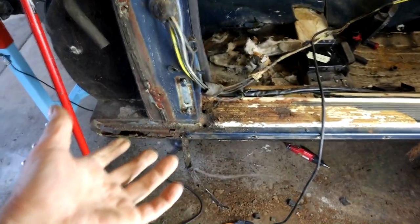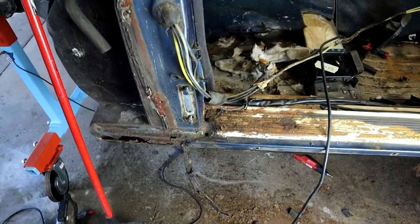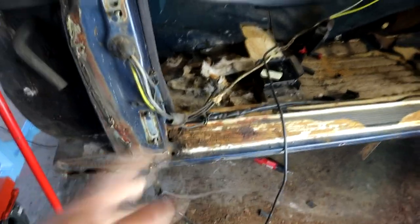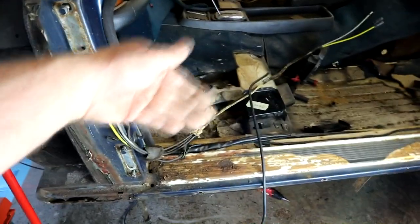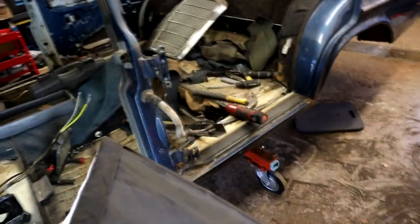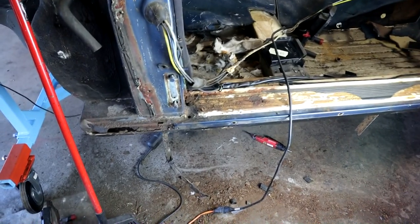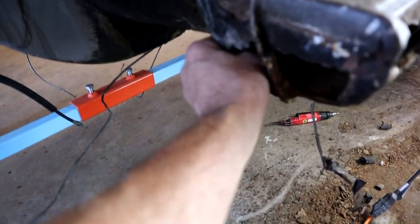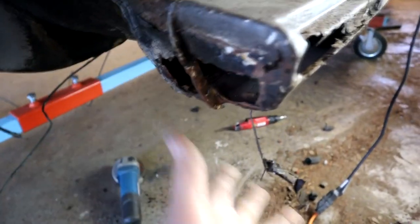This video obviously shows the damage extent, but it also gives you a good clue if you're looking at a 108 or 109. Key vulnerable places: pull the carpets back, check this inner edge where moisture gathers from leaky window seals, sits on wet carpet, and rots into the inner and outer rocker. Use a magnet, use common sense to see where moisture gathers. Make sure it's an original car, not poorly repaired. Watch out for patches people have slapped on — they can be hidden well, but often they're hiding something much worse.